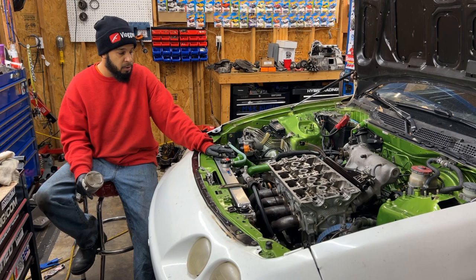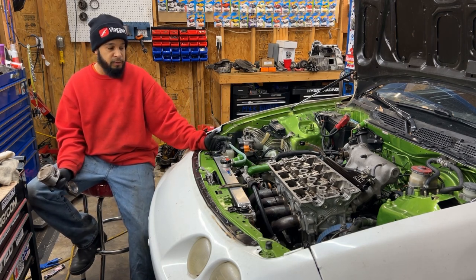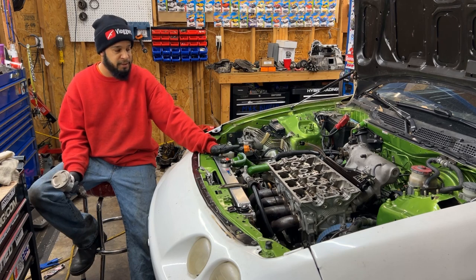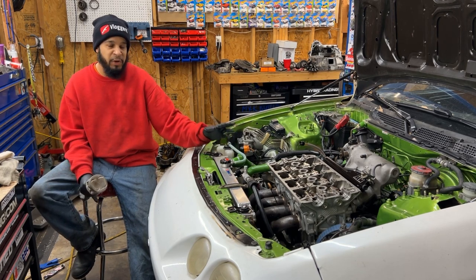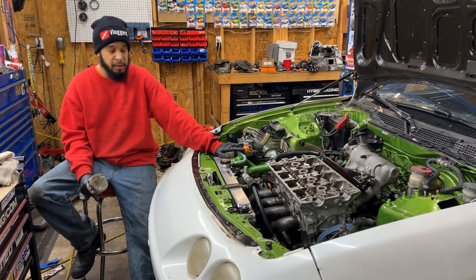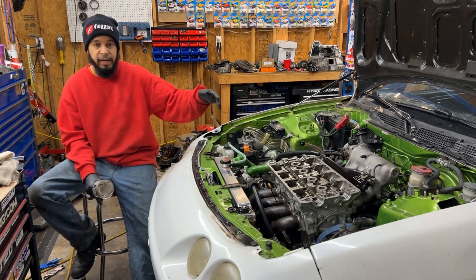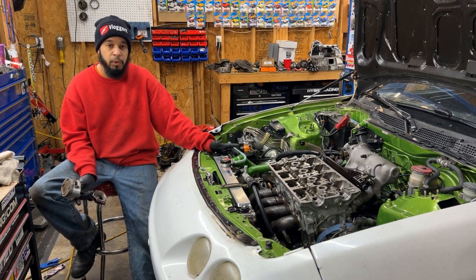I'm not sure they did the piston ring gap correctly for a boosted application, so I don't want to push this engine to its max limits. Since I didn't build the bottom end, we can save the Pro 1s for a different bottom end. We can do an LS bottom end or a GSR bottom end with forged rods and forged pistons. This is a built head already, so all I have to do is throw the cams in it, and we'd have a fully built motor to go with his turbo kit, if we want to.